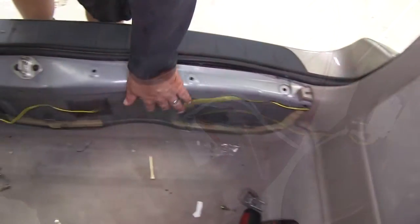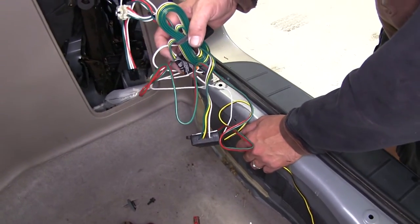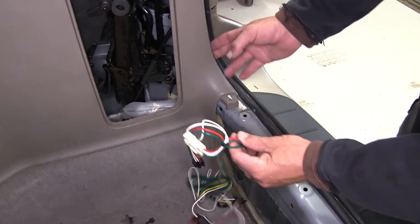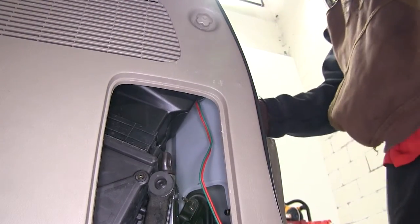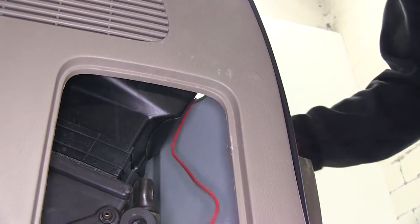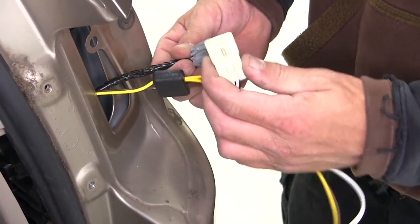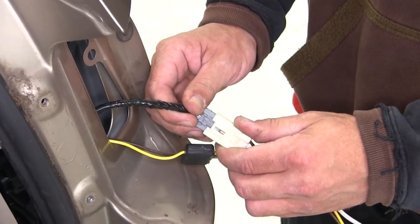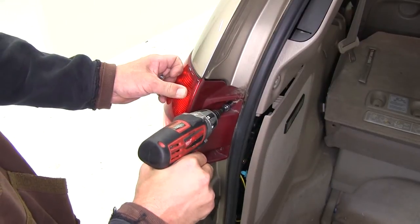Next, we'll take the rest of our wiring harness and route it over to the passenger side and feed it up behind the interior trim panel and out through the jack storage compartment door. Next, we'll take the green wire connector and feed it up behind the passenger side taillight assembly just like we did on the driver's side. Once we feed it behind the taillight assembly, we'll make the connection with the manufacturer's wire and then plug it in to the passenger side taillight assembly. Once it's installed, we can go ahead and reinstall the taillight assembly.